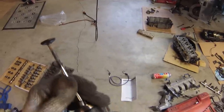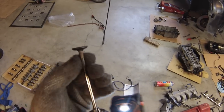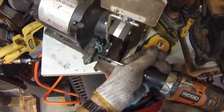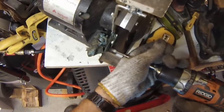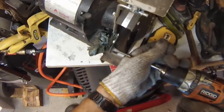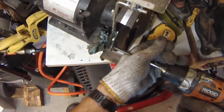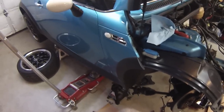A quick trick for those who don't have a home machine shop: I'm putting the valve into a drill to rotate it. That ensures I don't work on any one spot longer than another, keeping it nice and round. The valve is much harder than the wire wheel, so we can clean it up really well using this method — it basically burns through the carbon without affecting the valve metal itself. You can actually see the carbon underneath turning white as I scrape through it, and then the bare metal underneath is exposed. This method works really well — here's before with carbon, and after it looks like a brand new valve.